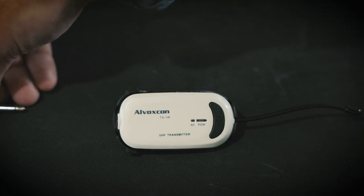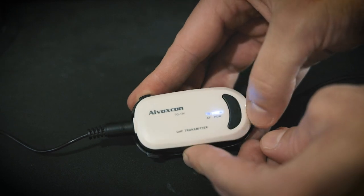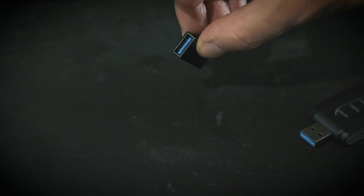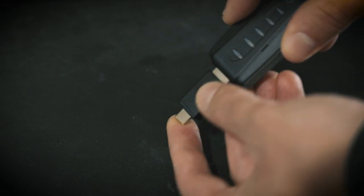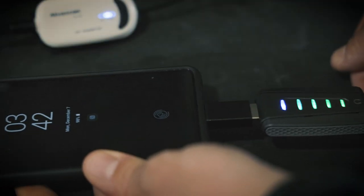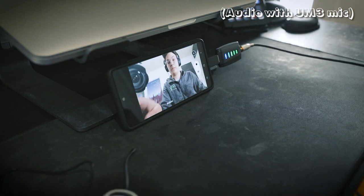Next I'm going to show you how to use this microphone to record audio directly into your phone. We're starting with the transmitter — I'm going to use the wired mic and plug it into the mic input on the transmitter. I'm going to turn the transmitter on. My personal phone is the Samsung Galaxy S20 FE which has a USB type-C port, so for the receiver we're going to be using the USB type-C adapter. This just goes right on the end of the receiver and then the USB type-C end plugs directly into your phone. The receiver is on — we have those five lights. I'm going to open up the camera app to see if we can get audio coming from the microphone.